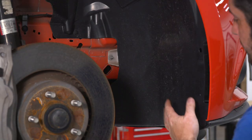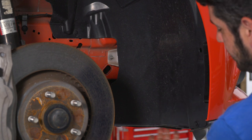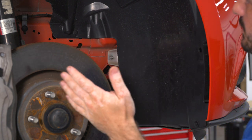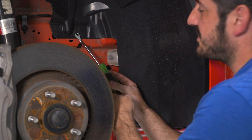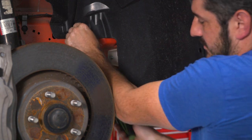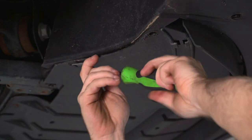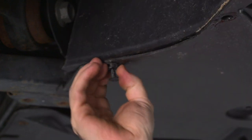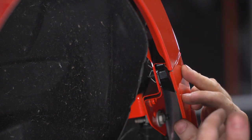Next, pull back the inner fender liner up against the front bumper. There are four clips on the inside of the wheel well, and two at the bottom that need to come out. Then pull the wheel well liner back far enough to gain access to the bolt behind the liner on the corner of the front bumper — use the clip tool to pull the clips out. Back at the corner of the bumper, there is a plastic bracket that mounts the fender to the bumper, with a 7-millimeter screw attaching the bumper to the fender. Remove it with a 7-millimeter socket and ratchet.